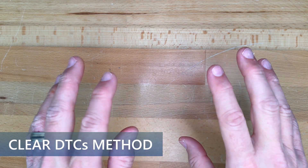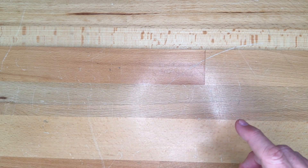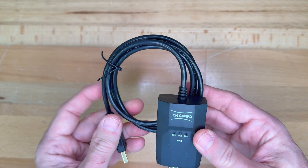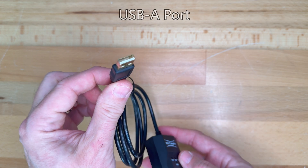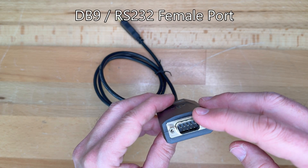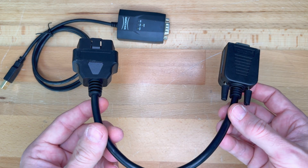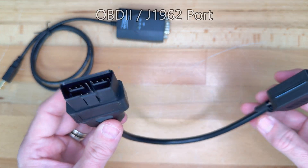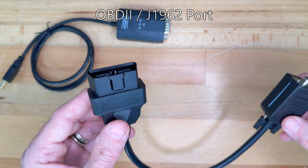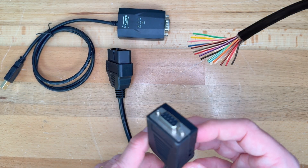Now I'm going to show you what you need to do to clear the DTCs that are affecting the fan and keeping it on. You need to purchase these items. The first one is a PCAN tool — I purchased this one on AliExpress. What this does is it connects to the CAN system of the car. At one end you have a USB-A plug that connects into a laptop, and the other end has an RS-232 female port. Next I got this cable — it's actually a combination of two things: an OBD-II connector on one side, also known as a 16-pin J1962 connector, and just wires on the other end.